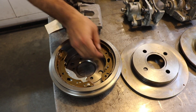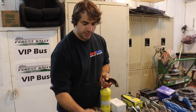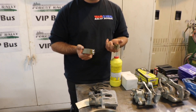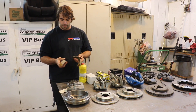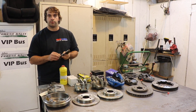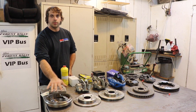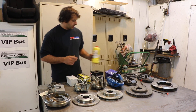So it's cheap to produce, which is good from that angle. Performance-wise, maybe not the best - you don't have the best heat dissipation. This is kind of a big heat sink and these can overheat pretty easily. We've used drum brakes on some of the production class cars where the rules don't allow changing away from the stock setup, and we actually had issues where the shoes would wear so quickly you'd have to readjust the brakes because the automatic adjustment feature couldn't keep up with how quickly the material on the shoe was wearing. So if you have a car that comes with drum brakes and you want to do some more spirited or competitive driving, you might want to look at upgrading to a disc and caliper setup.